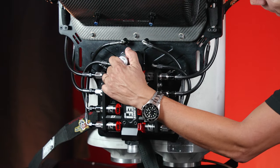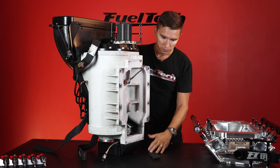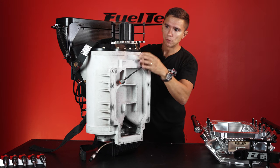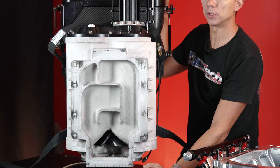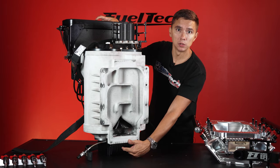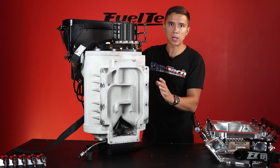Now I want to show you something cool. Here's where the air and fuel come out. You have the inlet at the very tip — the nose of the blower. Air and fuel go across the blower, compressing in stages, and all the way to the back you see the output. This output puts out both the fuel coming from the manifold and the air that was squeezed in. Right here is another burst panel — so you have two burst panels, one on the back and one in the front. This makes for a safer mount where if something goes bad, it won't be as catastrophic.